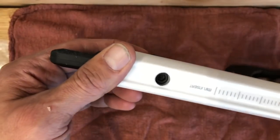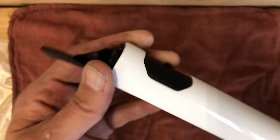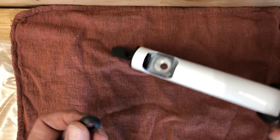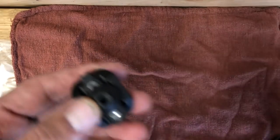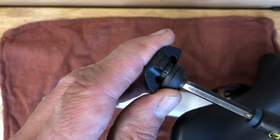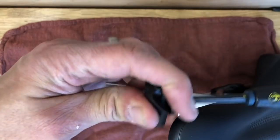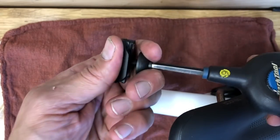Going to put the seat post in first to get it up in the work stand. The back side of the seat post has a little expanding wedge-type system — there's a little beveled aluminum section in there. The threads on this piece use a 5mm hex key and are actually reversed, so you turn it counterclockwise to thread the bolt in. When you're looking at it in the stand, you just turn it clockwise like a standard bolt to tighten the seat post.